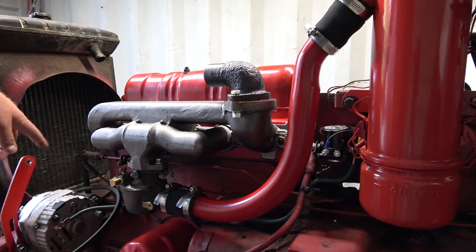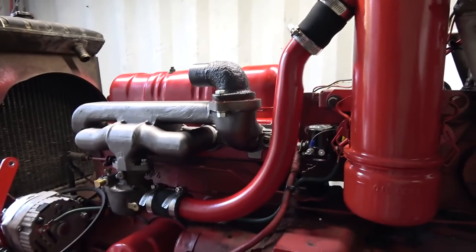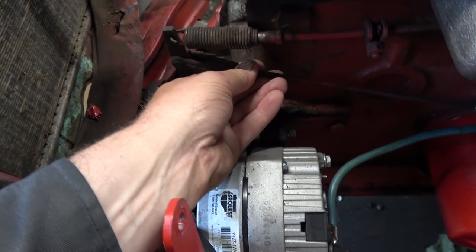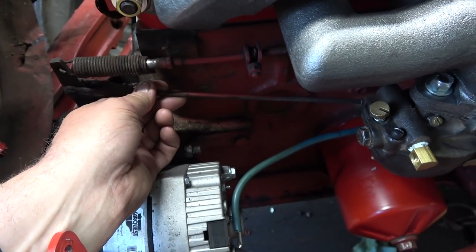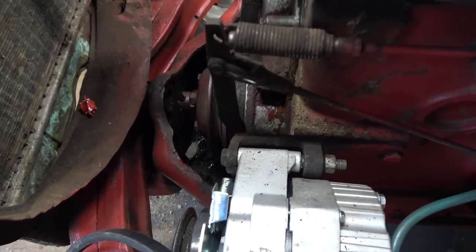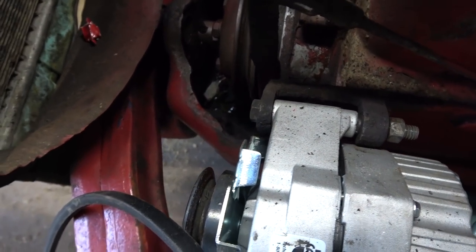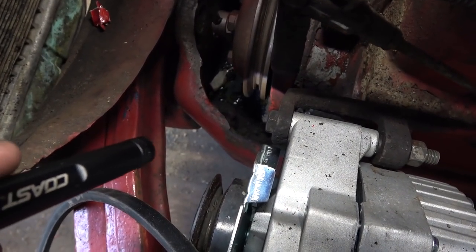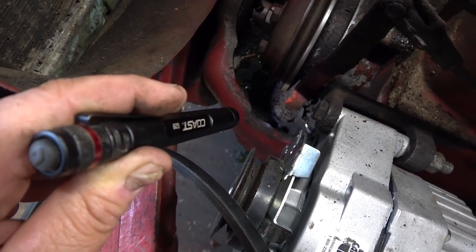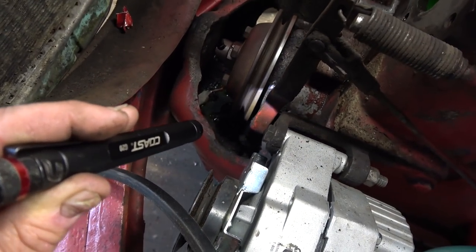But yeah, the governor arm and lever stuff, that's all gonna have to probably come off. I don't know what shape the governor is in on this, but let me show you where it is. Down here where this linkage is, it's all hooked to the throttle. So when it starts to lock down, it pulls the throttle open more, right? And your throttle valve is all hooked to there too. And that goes way down and it's kind of buried inside here. There it is there. See that, follow that arm down, right down until you get into there. So that's in behind there.